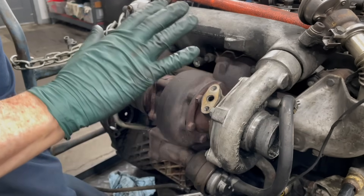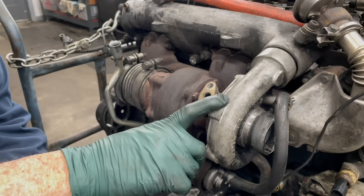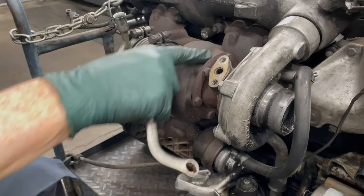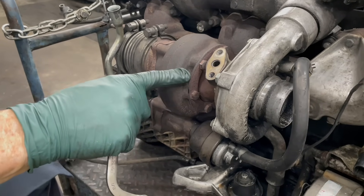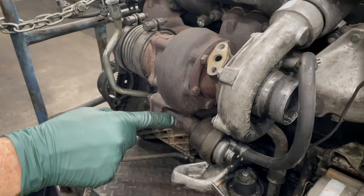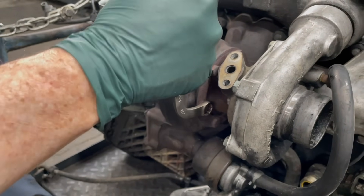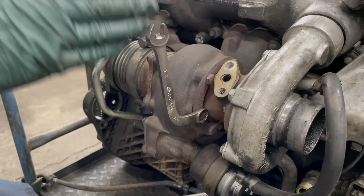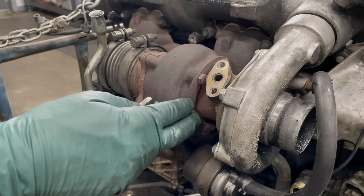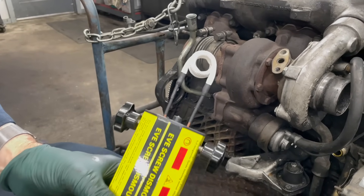All the other instructions are in my printed manual. Now there's one other tip I want to share in closing — if for some reason you can't even get these bolts to budge: I didn't even need to soak these bolts with rust penetrant today, but I do recommend that in my manual. Sometimes you want to let them soak — weep it in here and let it soak overnight. But let's say you run into a bolt that just won't budge at all, even after penetrant. Then you want to bring in some heat. I don't like to use propane around here, but this induction heater will loosen these bolts right up.